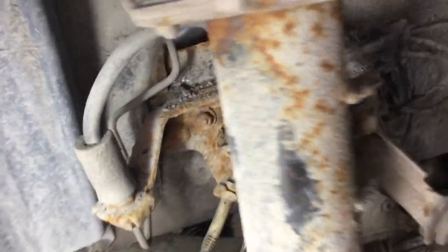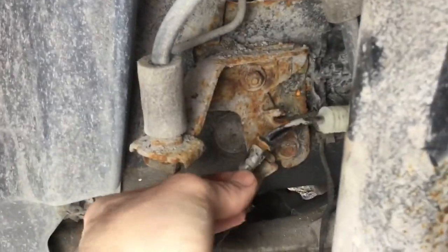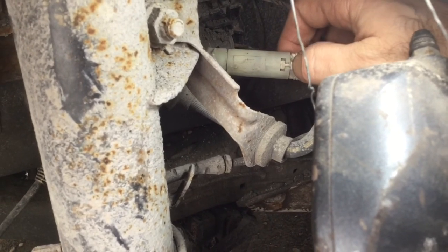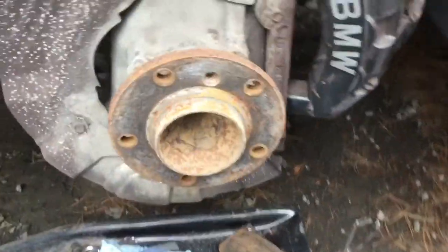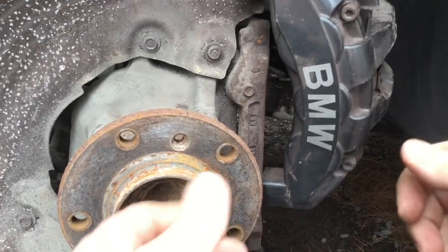To open the lid — the cover — you have to bend it a bit. It's kind of falling into the hydraulic hose on the back. Disconnecting this thing is no big deal — you take your time. It's a rubber connector and it gets a bit stuck because it's been there for a long time. To unplug the sensor, you have to squeeze this white thing here — when you squeeze it, it frees it. In order to remove it, you kind of need to rock it a bit, then you squeeze and pull, rock it again, and then it ends up working.